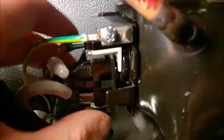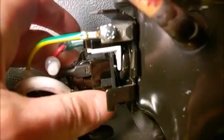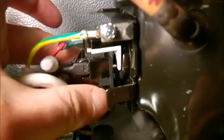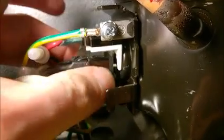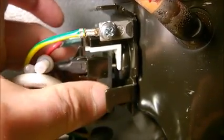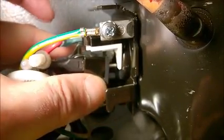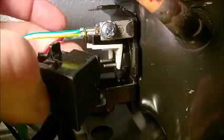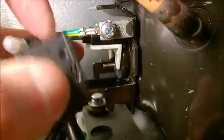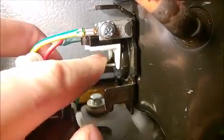Be sure there is no more voltage — maybe measure it with a multimeter. You want to wiggle the relay gently. Do not force, do not pull hard — you are going to damage those small pins. Just gently wiggle and be patient; it's going to slide out. It has two holes at the top engaging these two pins.